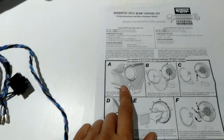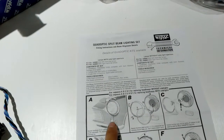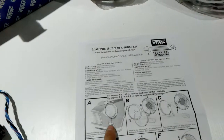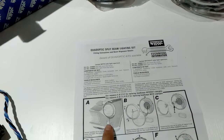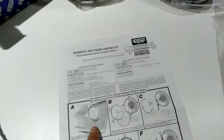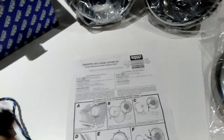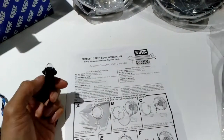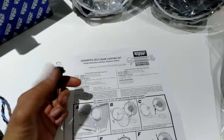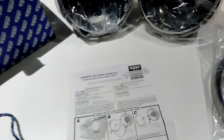So imagine that's a Mini. It's pretty close, but not exact. But the smaller lights down here, on my particular car, I'm using them as indicators, and that's pretty standard as to how it was in the Australian model. The only extra thing I've done is I've changed those lenses over for the orange lens, so that flashes as the indicator. And then inside the actual headlight, that's where it'll have a separate, in Australia we call it park light. So that'll be the standard light, and then click the switch up one more setting, then the main headlights will come on, and then also high beam if you want that on as well.